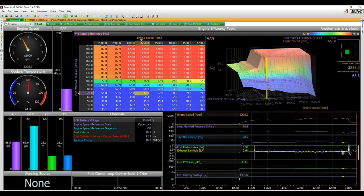So what it did was it tuned the site and took the closed loop, or the trim that was being used for closed loop, out. All right, and now that site is correct. You see there's been a change, which is why we've got a red diamond there, and the black square, or the black marker, to say we were on site when we made that change. And you can see here what that means is when this target is green, we're on site.